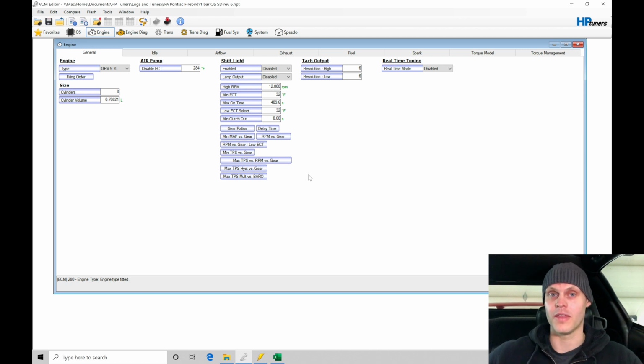We haven't talked about that in the Gen 3 course either. There's been some questions on that. I have developed an Excel spreadsheet that we can simply plug in some values from what we're working with in the file that we have, and based on the cam that we're running on our cam card, some of the opening and closing valve events, we can plug those in, and I have a nice corrected value that you can put right in to your file, flash it.